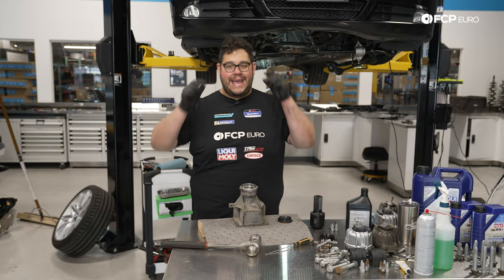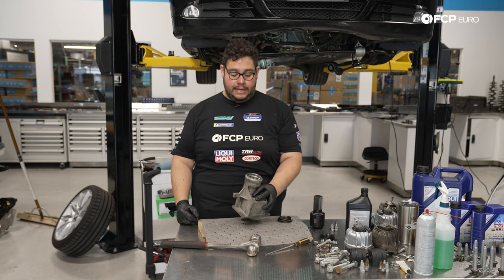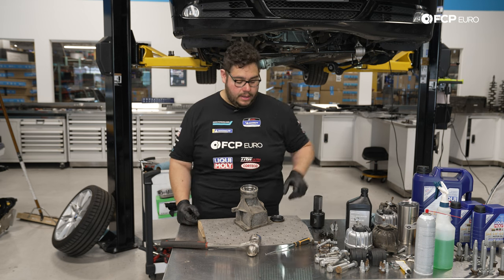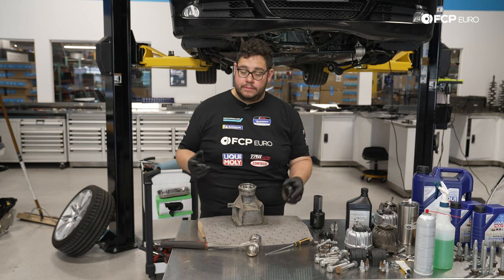We are on to the next step, which is gonna be servicing our output axle support and our diff. We're gonna be changing out the seals. Remember, we popped out the old ones earlier while it was still on the car. We have our new ones, and we also have our seal driver, which is linked in the description below.